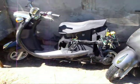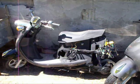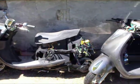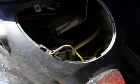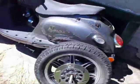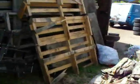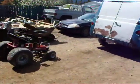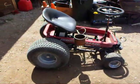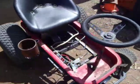When we were building this wagon, I did have a collection of these. We found one faulty controller with some bad MOSFETs, so we set that one aside — I might fix it one day. Then we pulled another controller out of this one; the controller's gone but the DC-to-DC converter is still in there. Hurtie pulled the controller out of that one and we put it on the wagon, and that one ran just fine. I use ebikes.ca — they have a troubleshooting site that makes it pretty easy to test your stuff and see what's wrong, whether it's the motor or the controller. That's the motor we used.